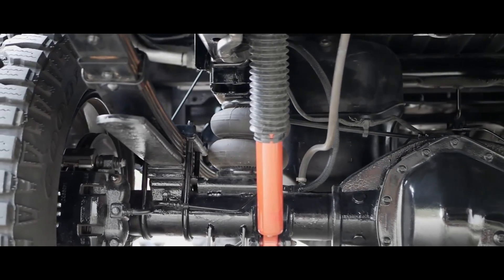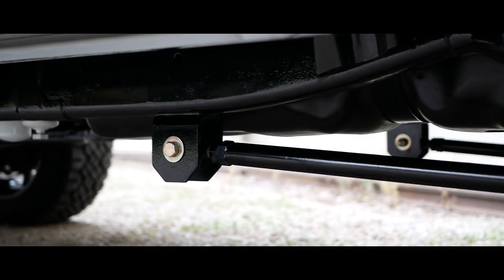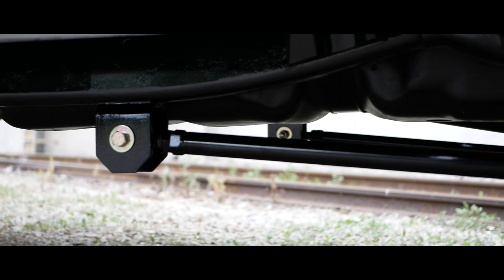With the Hellbent Steel leveling kit, instead of just putting a two-and-a-half-inch kit, I put three inches in the front. So I needed to bring the rear end up just a little bit to make it sit level, so I've got Firestone RideRite bags in the rear. Also on the rear suspension, I've got a set of traction bars that I fabricated myself. I drew the bracketry up in SolidWorks, had a local shop punch them out, and then I welded them onto the axle tubes and also the frame.